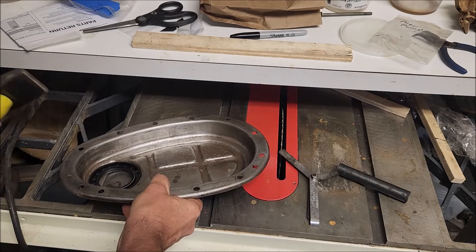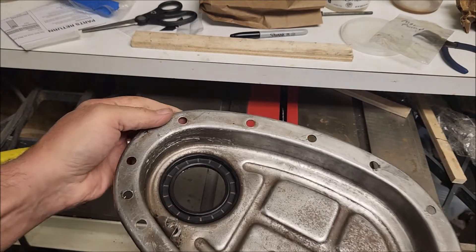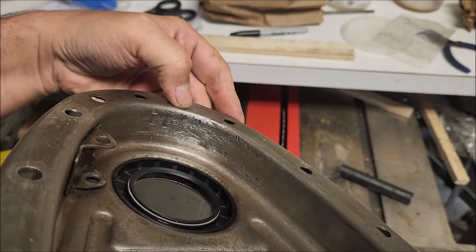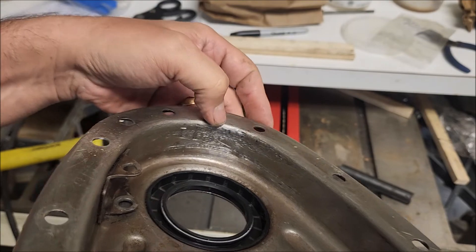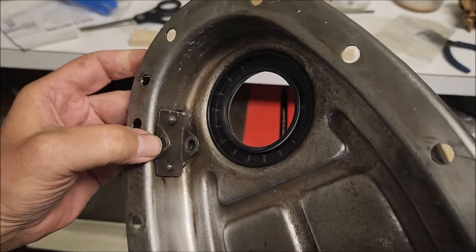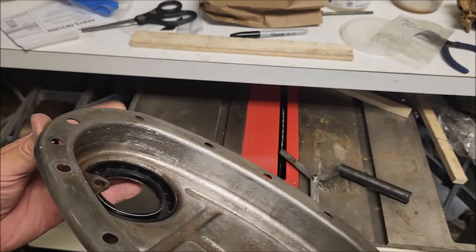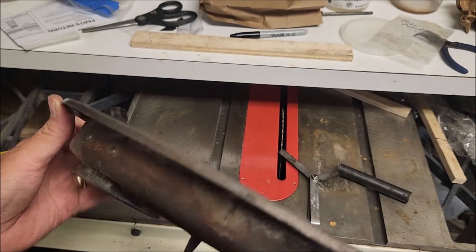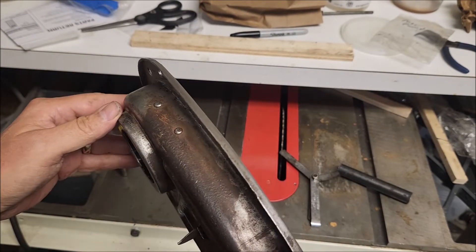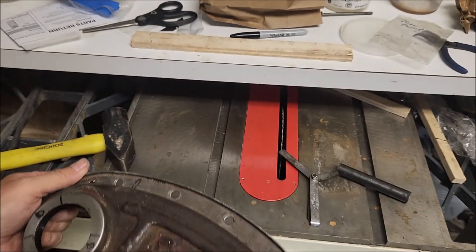That's the first problem — getting the dimples out. The second problem is that these can actually become warped. I bought this one off a friend who races, and you can see the marks from where the timing chain tensioner let loose and got all messed up inside. You can see how badly it's mangled. This one has seen a lot of bad history. It was also significantly twisted — when they took it off they weren't careful, just pounded it, and it was completely racked to the side.